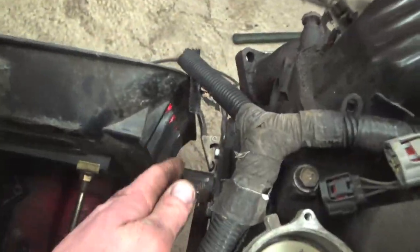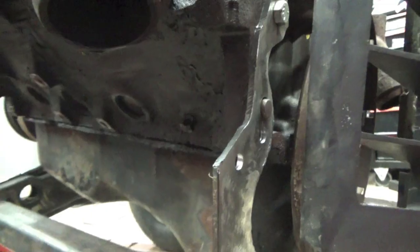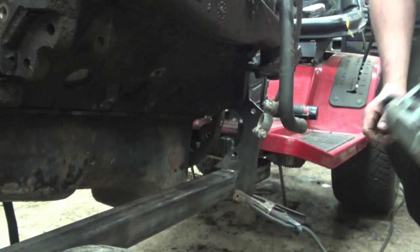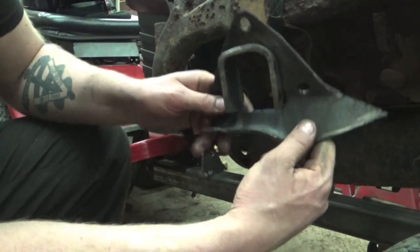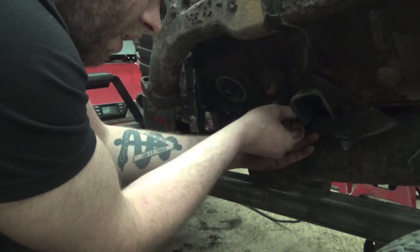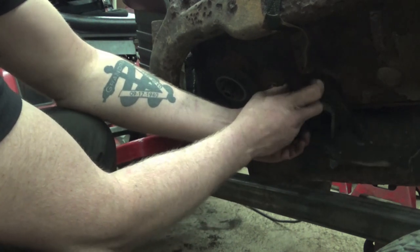We just got the motor mount plate bolted up, so we're gonna tack weld this into place and then test fit the starter. You can see where the starter's gonna be held right here against the flywheel. Let's see if the starter fits — looks like our starter's gonna fit perfect right there. So now we can start blasting this motor plate in, which is nice. They cut the motor mount off but it works great because we have a template for both sides to cut a plate out — that's gonna work out great. We're gonna use this motor plate to make our little plates for both sides, so let's get these traced out and plasma cut out on the bench.